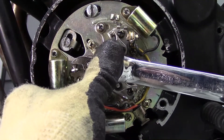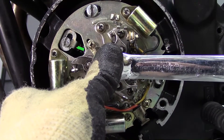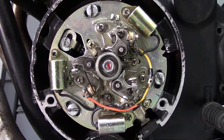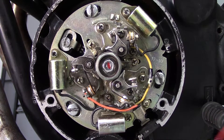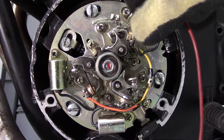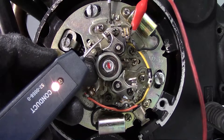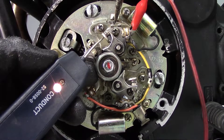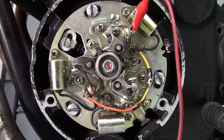The points for the other cylinders are set using the same technique. After rotating the engine to locate the firing mark, the difference here is that the frame stays bolted down. Remember all the screws I mentioned earlier? The other points are bolted down individually to the frame, so they have their own adjustments. Loosen the hold downs, and like cylinder number one, move the placement of the points until the light goes out, then tighten everything down. Once you're done, spin the engine a few times and then double check all your work with the tester. Sometimes the points can move as they're tightened down.